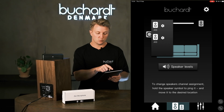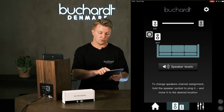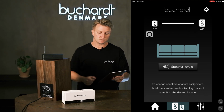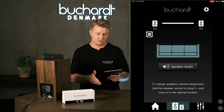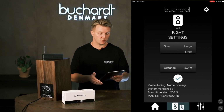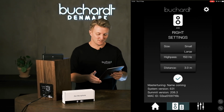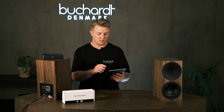So if we press and hold on one of them, it will emit a sound. That's this speaker over here, and we can just drag it over to the right position, and now you have stereo. So that's pretty easy. You can also drag it down to the subwoofer placement, but that's only if you have wireless subwoofers that will be needed. So another way to do this is to set them up from the remote.